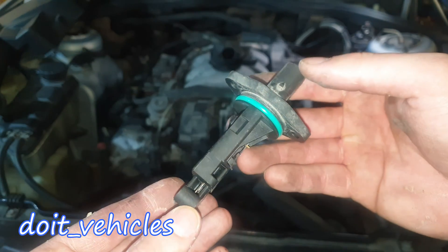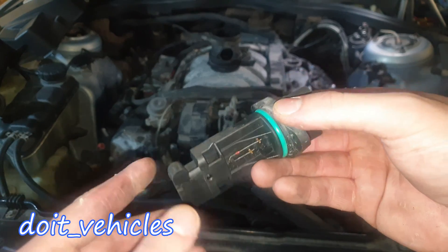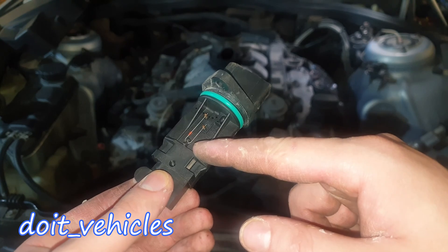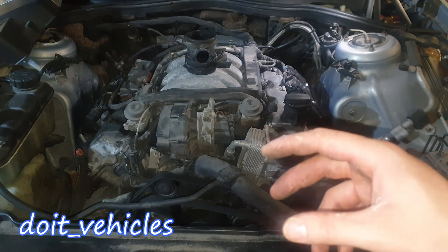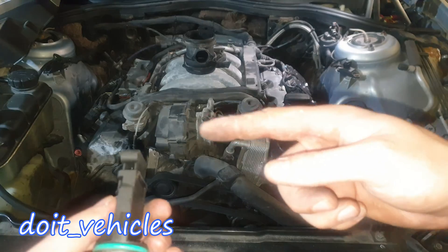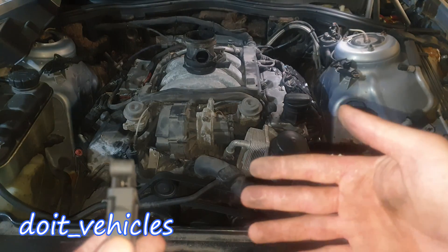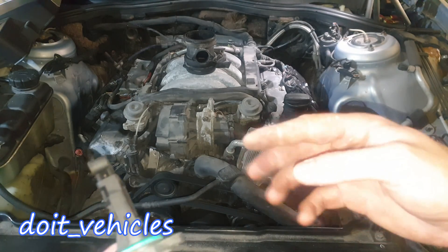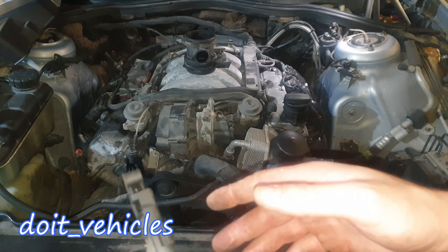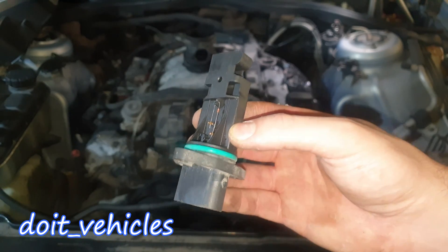Let's see quickly how this mass air flow sensor unit works. It has 5 pins, which are also numbered. 3 wires are going to be for the mass air flow sensor and 2 wires are going to be for the intake air temperature sensor. One of the hot wires inside is kept at a constant temperature of 100 degrees Celsius. Once air passes by, the current necessary to keep that wire hot increases, and that's how the computer calculates how much air enters through the tube. The computer is calibrated to calculate precisely how much air enters the intake manifold only with this specific intake hose and mass air flow sensor.